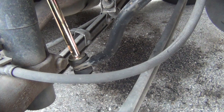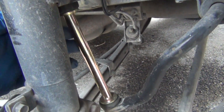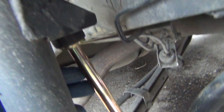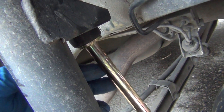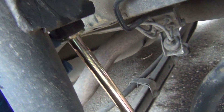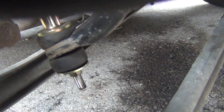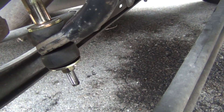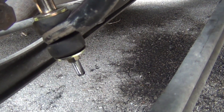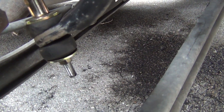I had to go to a friend's shop and have my rear stabilizer links cut off — the old ones. Here's the new one right here, and you can see the difference in the spacing. So I was getting excessive wear on my tires — buy a set of tires and they'll wear out in about a year, maybe a little longer. But that was the reason why they were wearing like they were.